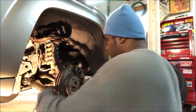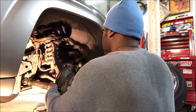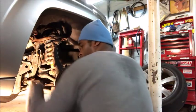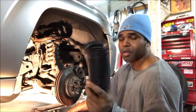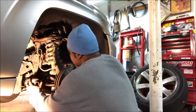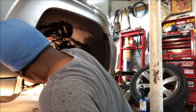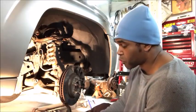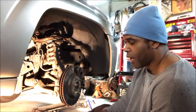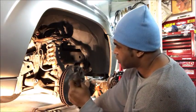Install — now it's got to be torqued down. For me, I'd rather use a zip tie — so much easier, you can tighten it down. Snip. We're going to replace the tie rod boot because this one's pretty good, it just needs the boot replaced. I did it a couple months back, so I got a new boot.